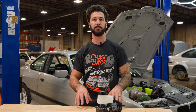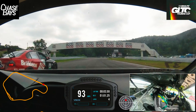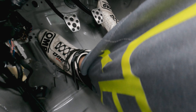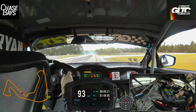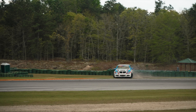A properly set up manual brake — with the proper master cylinder size, proper pedal ratio, and really good pads — creates the same exact braking every time. The modulation of max braking just before lock-up is where manual brakes really thrive. We call this the 90 to 99% zone. Finding the exact level of leg pressure to get that threshold is not possible with power brakes — they're just too inconsistent, especially with boost.